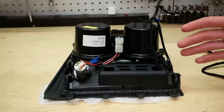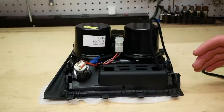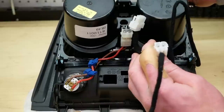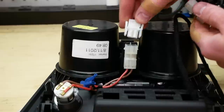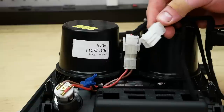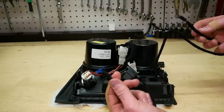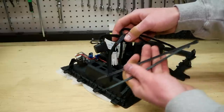The beauty of this setup is that it's completely plug and play — no cutting, crimping, or soldering of wires, thanks to this cleverly designed piggyback setup. This harness has the same exact connector as our cigarette lighter. So we'll plug the male section of the connector into the cigarette lighter, this connector plugs directly into the car's factory connector, and then the black connector from our wireless charging pad plugs into the black connector of the harness. Now I'll neaten up these wires with a couple of zip ties.